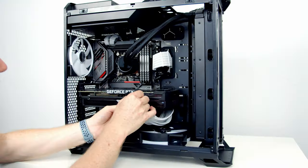So now we come on to look at whether you should go with an air cooler or an AIO. And taking a look at the idle temperatures, there's not actually that much of a difference. Under load, it's a completely different story, where with an air cooler, our CPU ran 12 degrees hotter. As you'd expect, having your AIO as a front intake, it's going to dump more hot air into the case, and GPU temperatures will go up, although they only went up by an extra 2 degrees with the AIO compared to the air cooler.